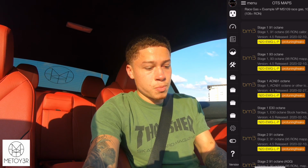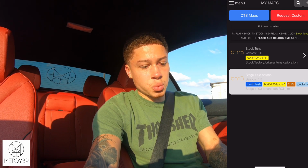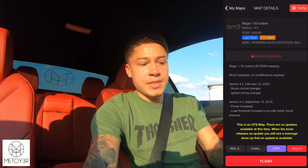So once you've downloaded the map you'd like, you're gonna go back to menu, and then you're going to press my maps. And you'll see on my screen I have stock tune, stage 1 93 octane. Stage 1 93 octane is the one I want, so I'm gonna go ahead and press that one. And then you'll see this screen, and it will say flash at the bottom.